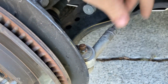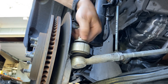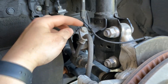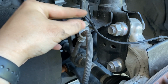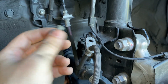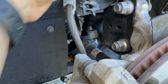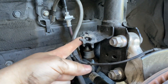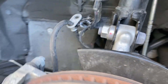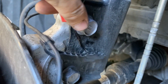I'm just going to put this down and let it hang. Remove the 14 millimeter bolts from the brake line. So that comes out - kind of pull this out and let it hang to the side. That kind of comes up and out. You just want to make sure it's off of that bracket there. Coming around to the other side, you'll want to remove the line bracket from the strut.